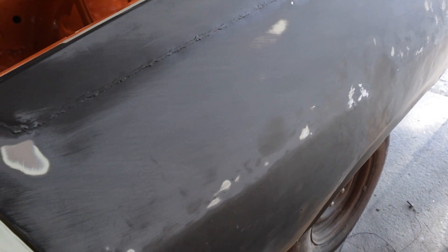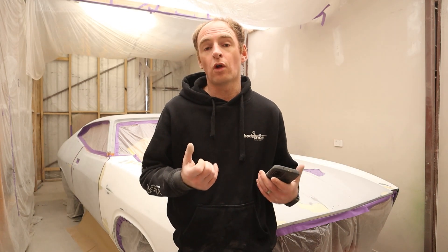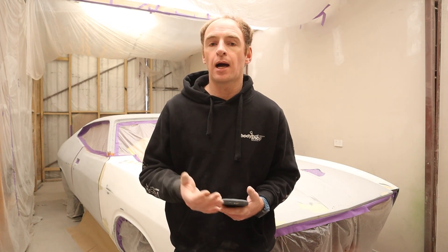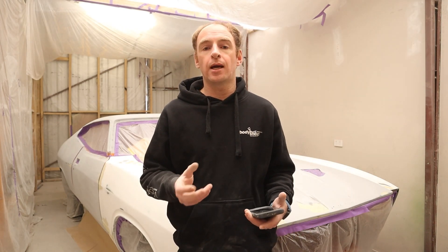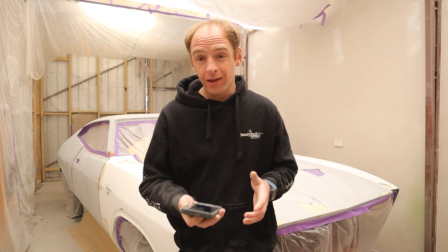How did I go about fixing it? Well, if you watched one of my previous videos, I basically pulled out a lot of the damage. The welding on the car in pretty much every spot had generated a lot of heat and had warped every single panel where rust was cut out — so that made repairing this car a bit of a headache. Over the 20-plus weeks it's taken me so far to get this car the way it is and as straight as it is, it's been by spending a lot of time basically blocking that epoxy primer down, making sure I can see where all the highs and lows are, and then repairing it accordingly. I think that answers that question.